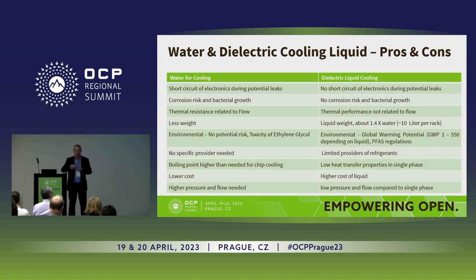Pressure is also important in designing a system. The liquid and water in standard systems need to be pressurized at very high flow rates. For example, the input tube is a four-millimeter tube because there's very limited flow — about 10% of the amount of liquid needs to come into an evaporator cold plate compared to a water-based cold plate. So pressures are low, nylon tubing is enough, and while you don't want leaks, you're not afraid if there ever is one, because it doesn't cause any damage.